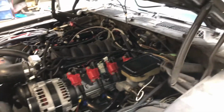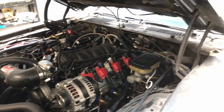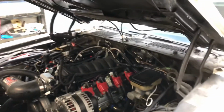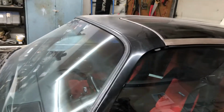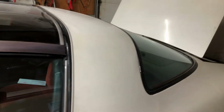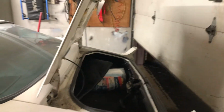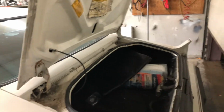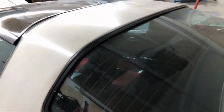Anyway, our fuel, the highest octane fuel that they sell over here is 94 octane from Petro Canada, of all places. Petro Canada bought out Sunoco, and when Sunoco existed here, they were 94 octane, so now Petro Canada is 94 octane. I believe Shell sells 93 octane, and Husky's another gas station that sells 93 octane. I think they both have a little bit of ethanol in it, but that's what everybody keeps yapping about, the E85 ethanol fuel, because it's a higher octane, it's got alcohol in it, which runs cooler, less pinging action. But the 94, what I got in here now, works fine.